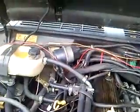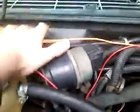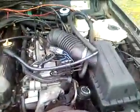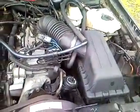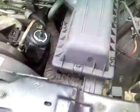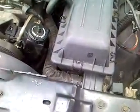I'm going to reroute the intake. I want to move it over to here. This is the cruise control. Take this out, and then run a hole right through here into that little vent where the windshield wiper motor and stuff is. Basically move it out of the way because I get a lot of water through here. I don't have any of the fender flares or the fender guards in the front anymore. I sucked some water in one time, and I did not like that.